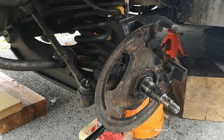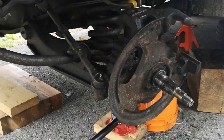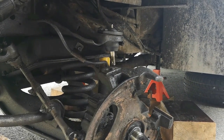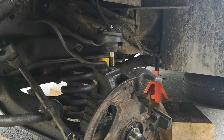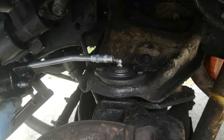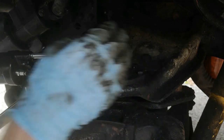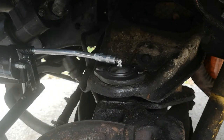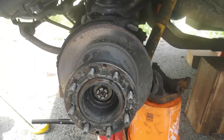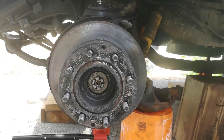In order for the ball joint to fit through that hole, I'm going to need to jack up the knuckle — it's incredibly heavy and under tension. I'm thinking I can slowly jack it in and guide it through, then put the castle nut on. I've also put in a grease fitting here that I can actually access, as opposed to the one the ball joint comes with, and I'm going to pump some grease in.